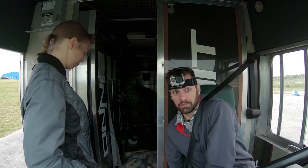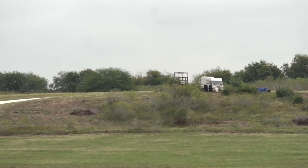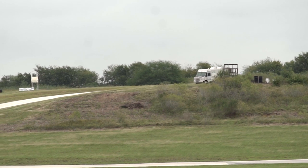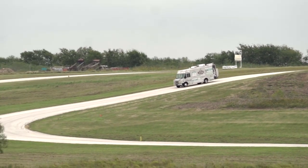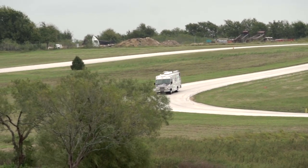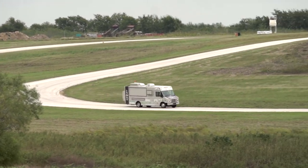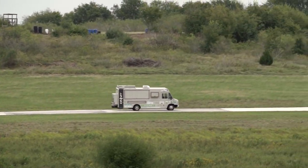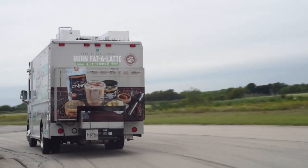This was eerie. The body has no cross bracing. It's like this. Take a shoebox and glue 2 rulers to the bottom of it. Now pick the shoebox up with 2 hands and give it a twist. Yeah, it's not going to hold its shape. Now this food truck's going around the racetrack. It doesn't want to hold its shape. There's no cross bracing along the sides of that box or the top. The only thing holding this vehicle together is the ladder chassis down below.